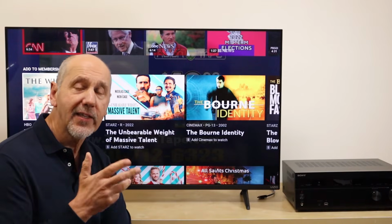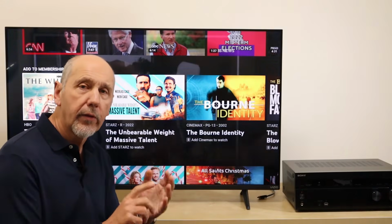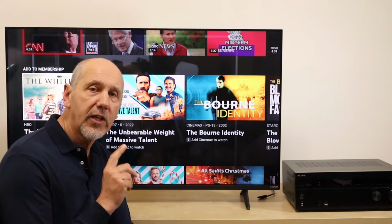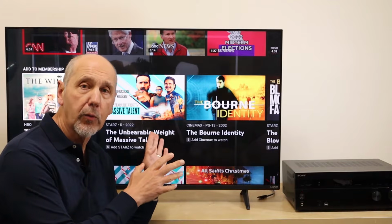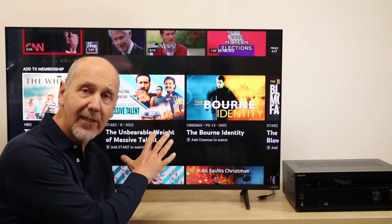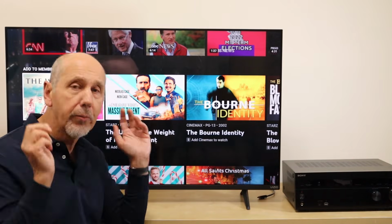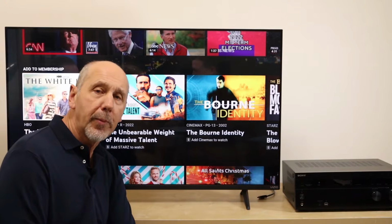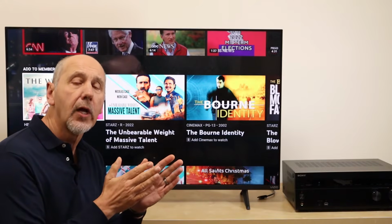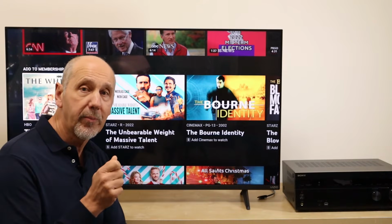This video is about the things I learned about Bluetooth headsets with TVs and the solutions to problems that I found. There are three problems that people run into when they try and use Bluetooth headphones with a TV. The first problem is that most TVs, particularly older ones, don't have Bluetooth in the first place. Secondly, the power from the Bluetooth from a TV can be a little bit on the low side, and that causes a problem of dropouts when you move your head or you move around the room. The third problem that people run into is that sometimes the audio on Bluetooth lags a little bit behind the video, and so the sound doesn't match the lips of people when they're speaking. And that can be very annoying sometimes.